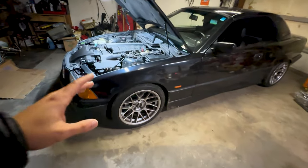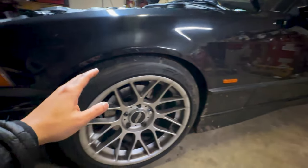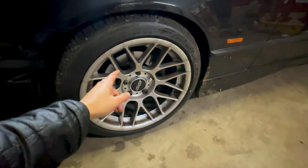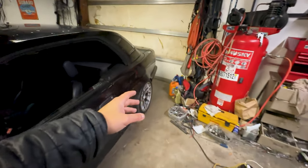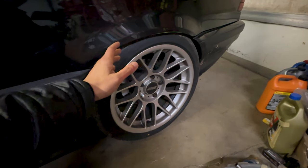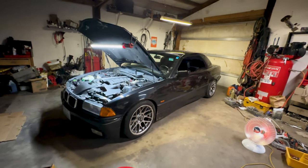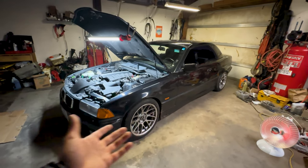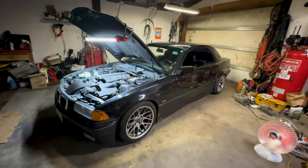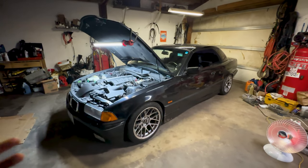With the Apex ARC-8s, this is a 17x9 with a +30 offset squared off. A lot of people don't run the flat-face setup — which I believe is like a 17x8.5 or 17x8 — and that doesn't lead to any rubbing issues. I had to spend so much time getting these rear quarter panels and fenders to clear for these to run. It's just something I think is worth the sacrifice especially from an aesthetic standpoint — because the definitive goal of the concave wheel isn't to make things difficult, it's to provide more of a contact patch with a wider wheel, and then you get the aesthetics of the concave face which really transforms the car.